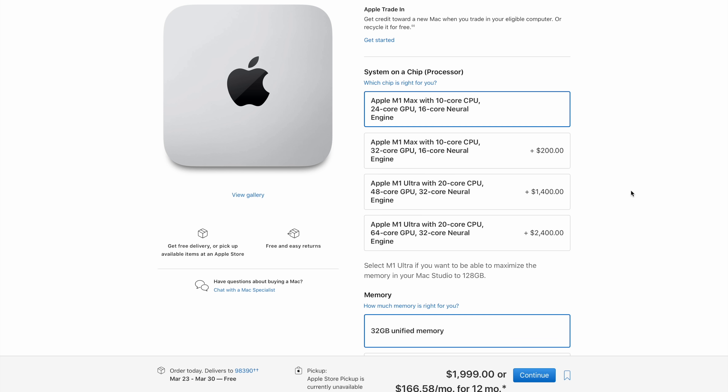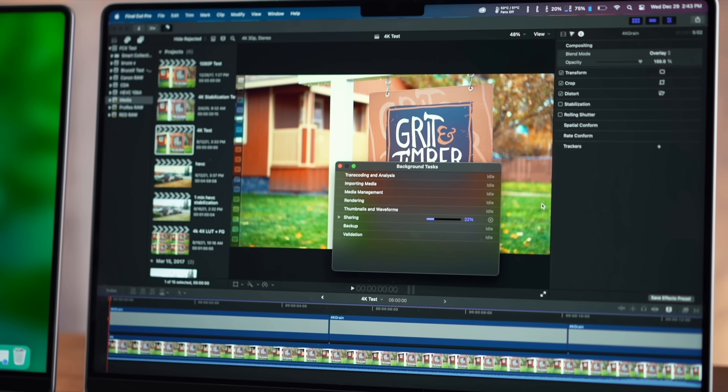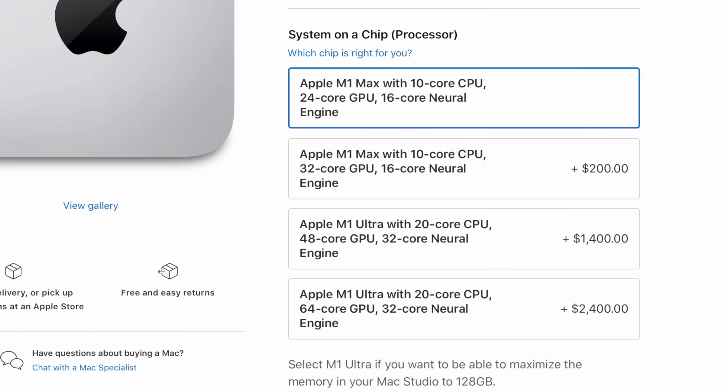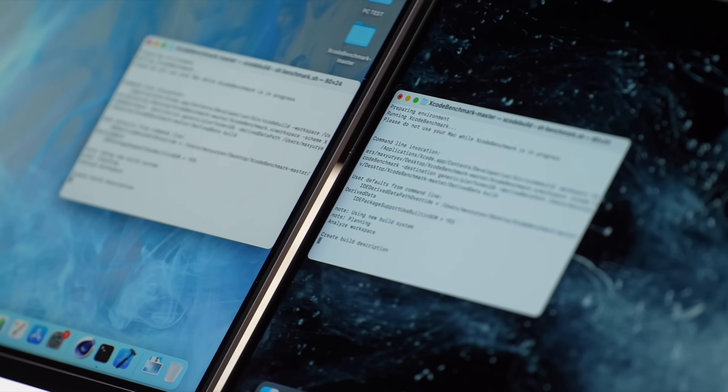Opening up the configuration page, the first thing you see is which chip and how many graphics cores you want. Don't make this mistake: when you upgrade to more graphics cores on the base M1 Max, you are not getting extra Thunderbolt ports, more encoders, extra bandwidth — none of that. It's simply a little more graphics performance. In real-world tests with high-end M1 Max chips, we are often not limited by graphics performance. Apple has so much dedicated hardware that it's often other things like encoders or decoders that are the bottleneck. For CPU-limited tasks like Xcode or photo editing, you will not see any difference whatsoever.